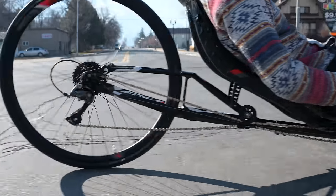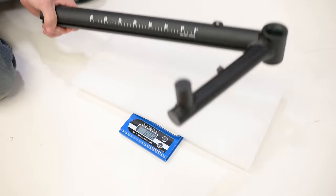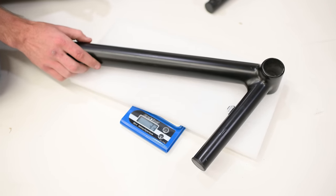A hollow pin chain can save you nearly a pound. Depending on the trike, swapping to a carbon fiber boom and carbon fiber wheels could save you another two to five pounds. After the big stuff, there are other options to save ounces and grams at a time, but you will pay for it as the lighter weight components are typically made of exotic materials that are cutting edge and expensive. And while all of those things might make it easier to climb hills, it may not make you faster overall, which is why we recommend this as our final tip.